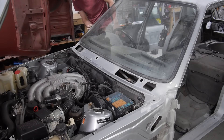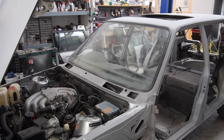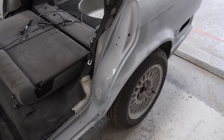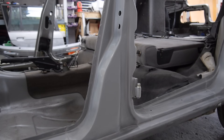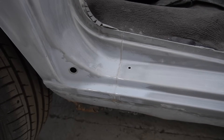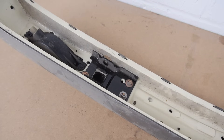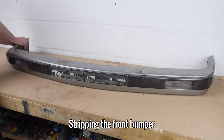So after many, many hours, this is most of the paint prep on the chassis done. I still need to remove all of the zinc primer and replace it with epoxy primer, prep that to the same level, and prep underneath the windscreen once it's been removed. The two doors I'm keeping are done, but I will need to prep the two I'm replacing once I find them. The front and rear bumpers need to be repaired and prepped for paint, much like the chassis. But before I can do that, I need to strip them of their parts, starting with the front.